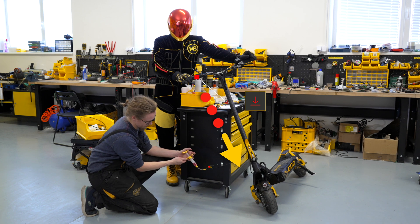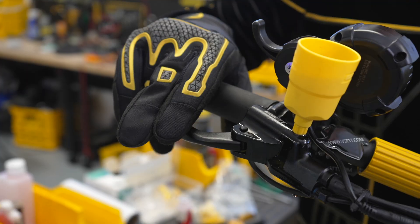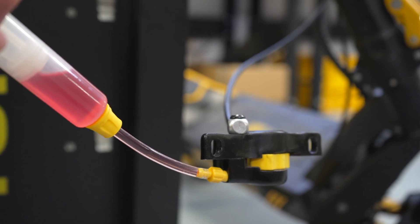Repeat the whole process until you no longer see any bubbles passing through the tube while pumping the brake. Also, there must be no bubbles coming into the funnel when the syringe is pressed.